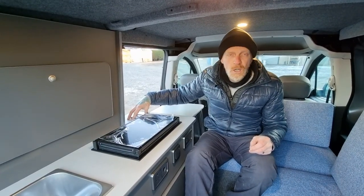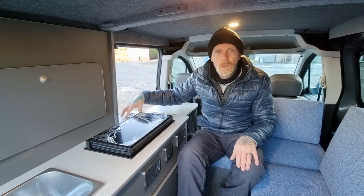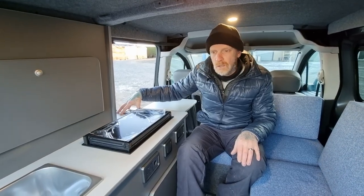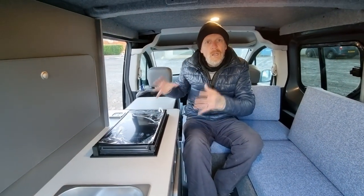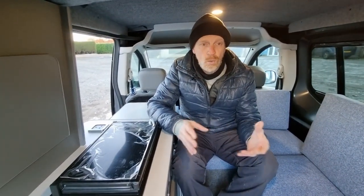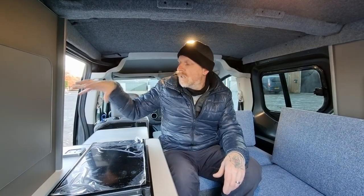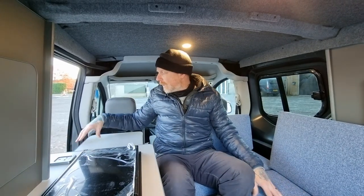As long as you're not cranking it up to the full 2000 watts, a little fan heater will run for quite some time. The alternative was fitting a diesel heater, but those need a separate tank — where do you put it in a van this full of equipment? You also need a hole in the floor for the exhaust inlet and outlets, and there's not much free floor space under the vehicle. So it was just less hassle, less expense — they've opted for the inverter with the upgraded leisure battery, and it works absolutely fine and we can definitely vouch for that.